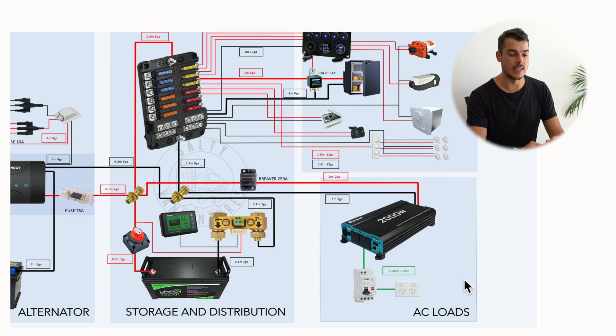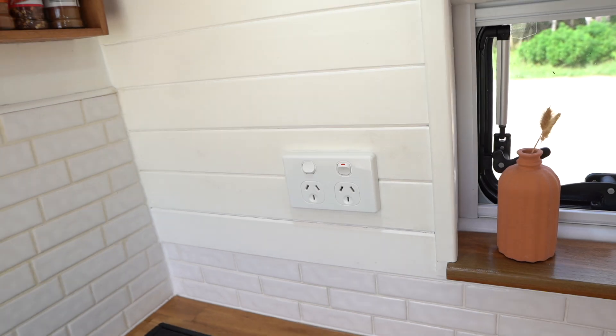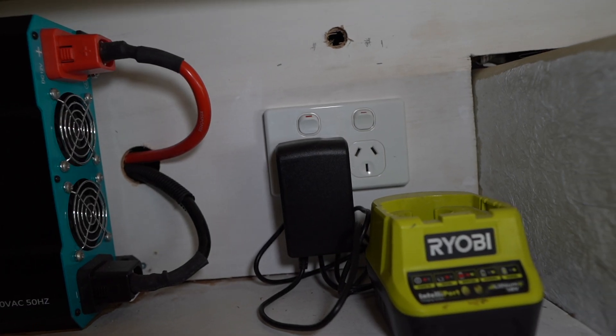This is our 2000 watt Renogy inverter. I won't show exactly how I've wired this in because legally in Australia I wasn't allowed to — I had to get a licensed electrician to wire in my inverter. I wanted extra power points around the van, so I had to run cable and have the electrical system protected with a proper circuit breaker. Essentially it goes from the power outlet of the inverter to a circuit breaker and then distributed to my three power points around the van. Also note: you don't want to connect your inverter directly to your battery — if you're running a shunt, you want to be able to measure the voltage going in and out when using your inverter, and connecting it directly to the terminals bypasses the shunt.